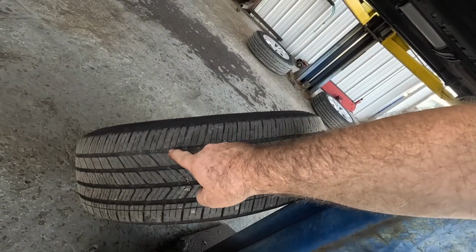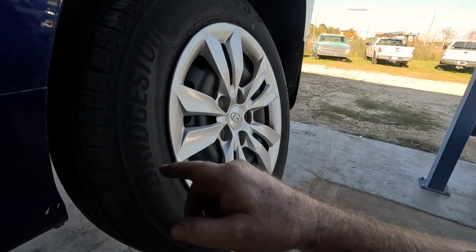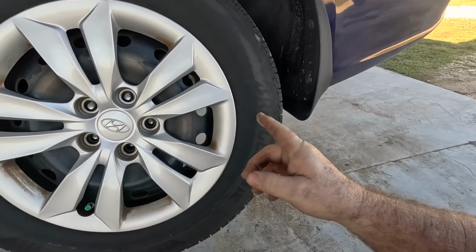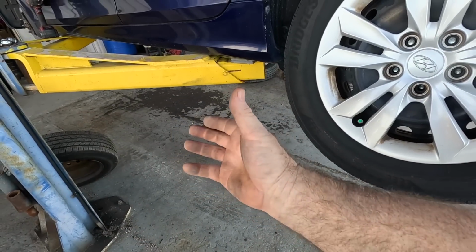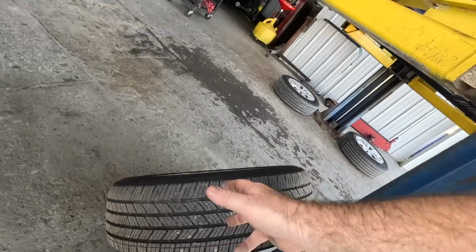The only problem is these tires aren't as good as the rear. You generally want the better tires in the back. That is going to be interesting. I'll have to ask them up front if they want to put the more worn tires in the back because of the camber wear. Try to make them last a little longer, but they're basically already touching the inspection bars. So that's going to be their call up front.